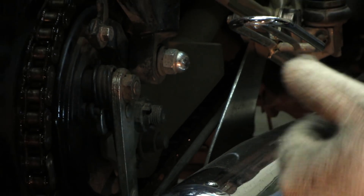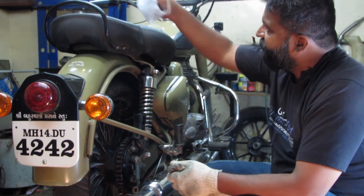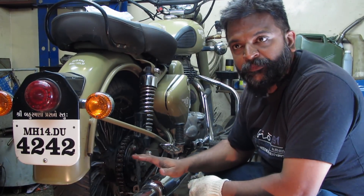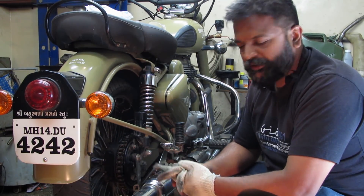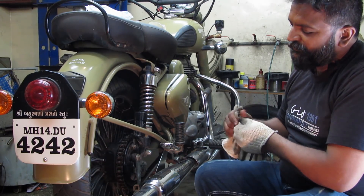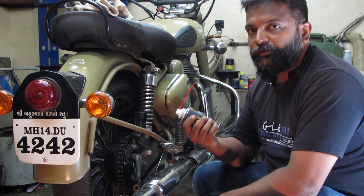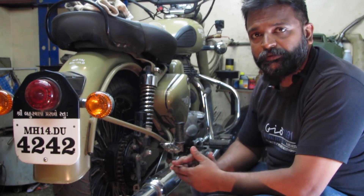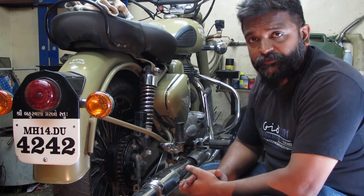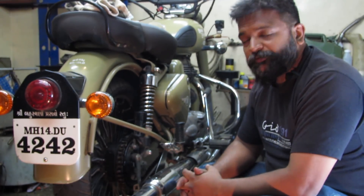So I have cleaned the chain, removed the rust, and applied the chain lube. After this, as you can see, the chain is quite wet. You can ride the bike for 100 to 200 kilometers and later on use the cleaner as well as the lube again — that means you'll use the kit a second time after this job because it was too rusty. This is how you take care of such a job. You may have this issue in the range, or if you haven't been using the bike for a long time. Thanks for watching and keep connected.